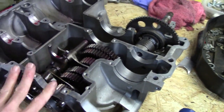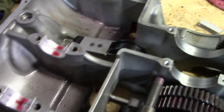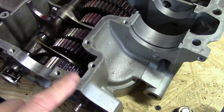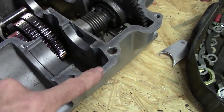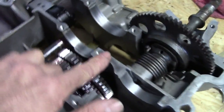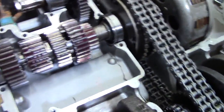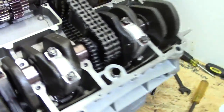I've got all of the transmission stuff in here — that didn't get removed at all. All of this stuff stays in place and we're going to have to clean this up a little bit. It's got some dust in it. I'm going to clean all the bearing surfaces, get some fresh assembly lube on all those bearings. We're going to clean this surface really well, scrape any old gasket material off. This is where the Honda Bond is going to go — on any of these surfaces where there is a mating of two pieces of metal, every single one of those spots all the way around. We'll put it on this side so I can grab this with my hands and not get the Honda Bond all over my hands and smear it around.